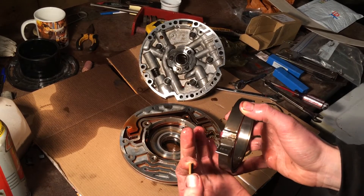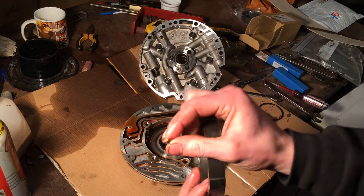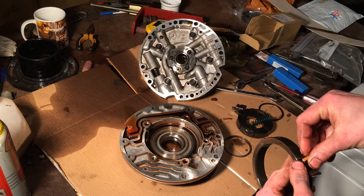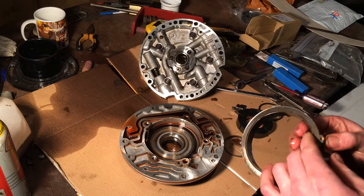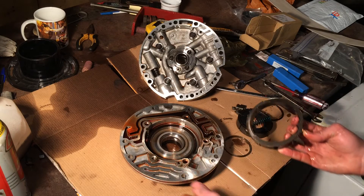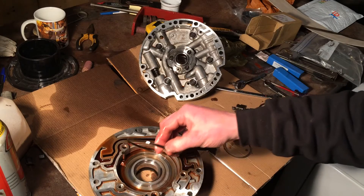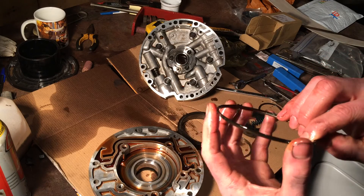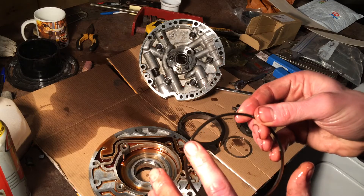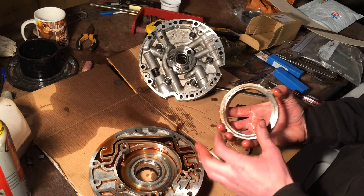There's actually another small piece — it's like rubber underneath that little plastic piece, so I'm just going to leave that in here for right now. This housing was laying like this when I removed it. On the bottom you can see there's a groove, and that groove is for this — it appears to be a larger ring with an O-ring on top. So it's a metal ring with an O-ring on top, and that sits underneath our housing.